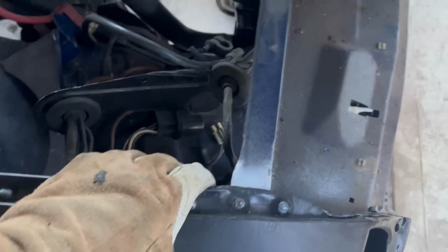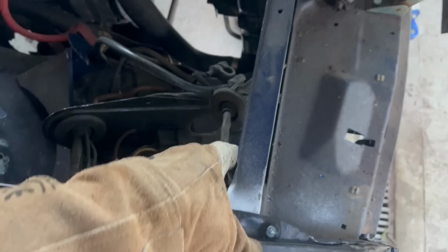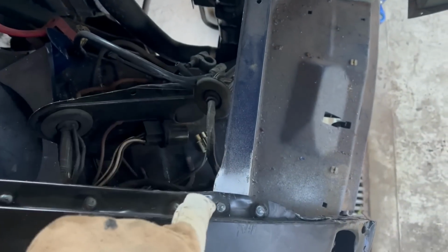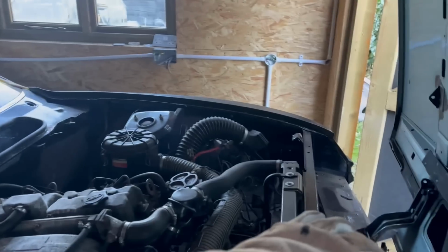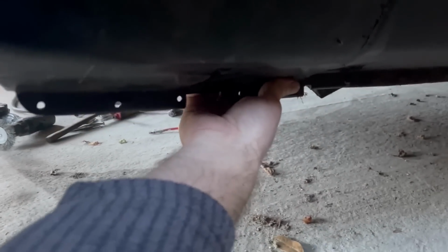Same on that side. You know, if that ever rattled loose and popped, it wouldn't sort of spring away here. It's probably overkill, but it tidies it up a bit as well, stops water getting in there. So get the drill, clean that off, clean all down there, stitch in there, stitch across there, same the other side, weld that wing on. Don't seem to have the same problem this side. It worked out nicely, so when that is pushed up, that fits all good and it's not baggy and horrible. So that is what I shall do, and I will then wheel outside, grind off all the welds, and the wings will be ticked off.